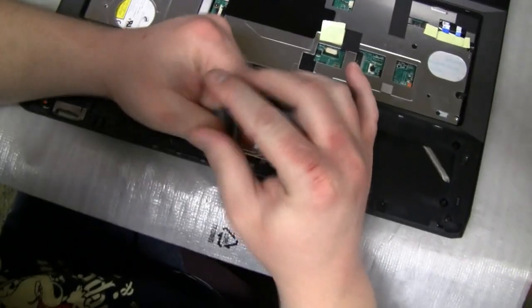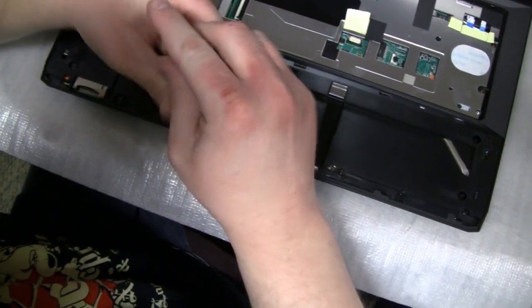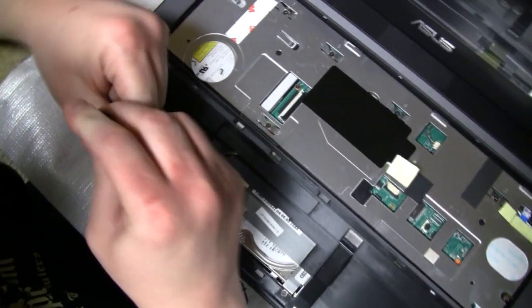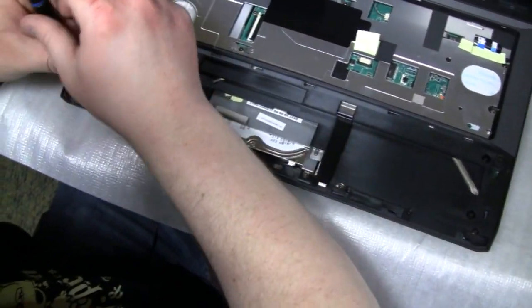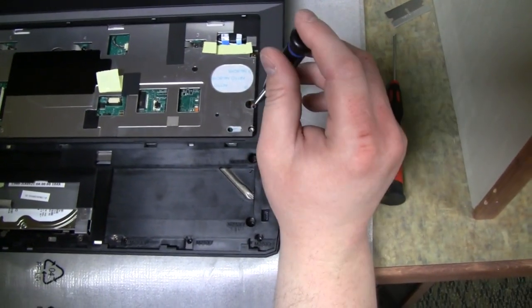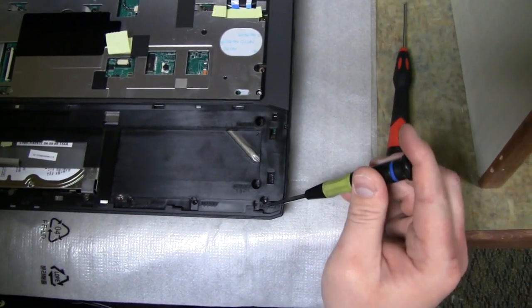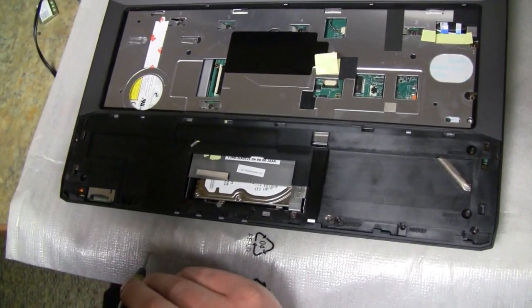Just keep moving our way over here, removing screws as we go. The screw right here is our final screw. If you didn't remove this screw up at the beginning — the one under the keyboard — that could be the reason the panel isn't going to open up for you. So to recap, the screws holding the panel are: the one under the keyboard, the ones we just removed, skip the hard drive bay screws, then continue across.